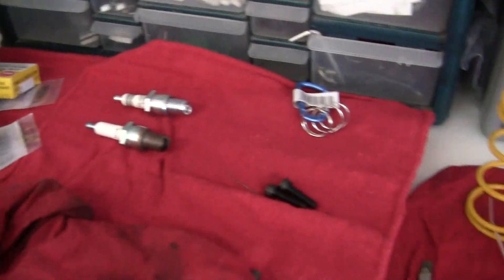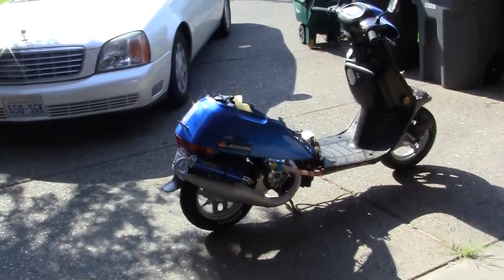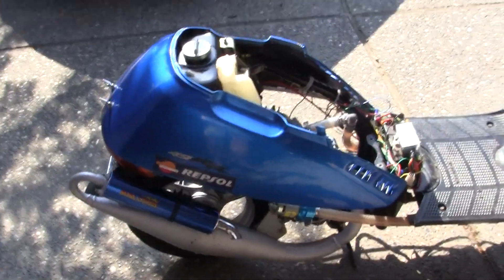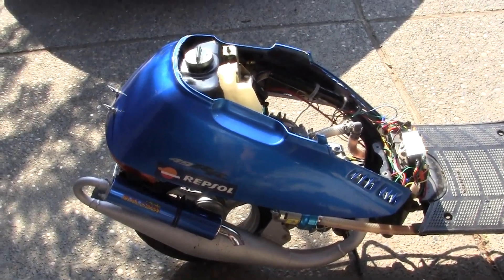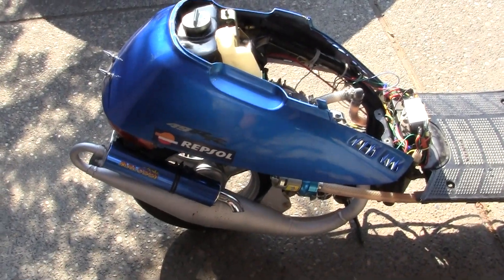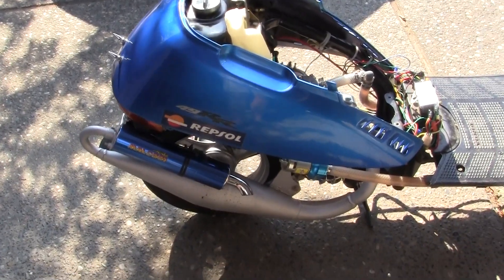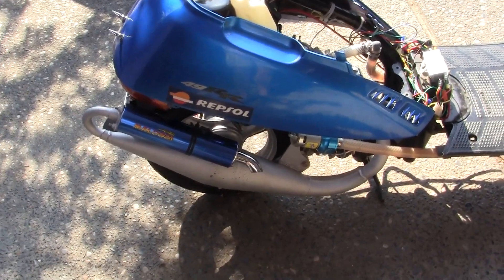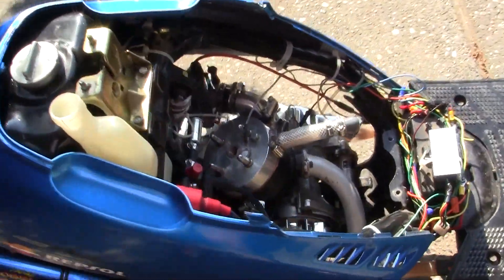I'm still experimenting, and I'm just glad right now that there are no signs of leakage on the plug. Another thing I've noticed is that if you do have water or fluid leaking into your cylinder, your exhaust will get very, very loud — because that's the water compressing and exploding in the exhaust. This exhaust is a lot quieter right now. I haven't noticed any leakage anywhere.